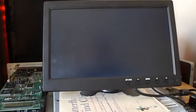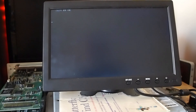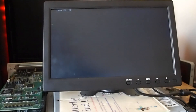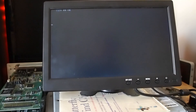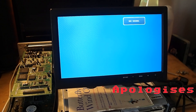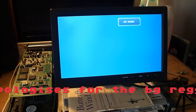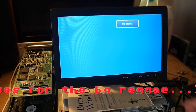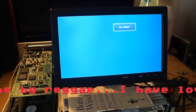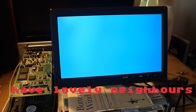Basically I wanted to make sure it booted okay and was worth carrying on with. So what we can do with this machine is just skip the error and check it goes as far as it should. And so here I've got DOS 6.22. What I'd like to do is see how it responds to that and make sure the floppy drive is actually working. I did think about cleaning the heads first but decided I would take a gamble — and it's paid off.